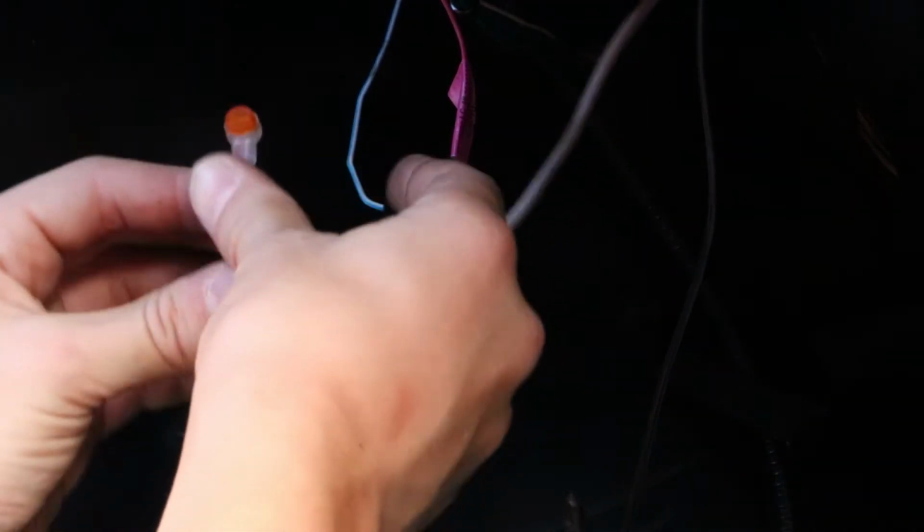And here you see the connection for the remote turn on. I use these things called Scotch locks. They basically work like soldering two cables together. It's just way easier. You put the cables through these two little holes for them, and you just squeeze it and it connects them together. Really simple way to connect cables up, and you can get them from eBay for cheap. Links below in the description.